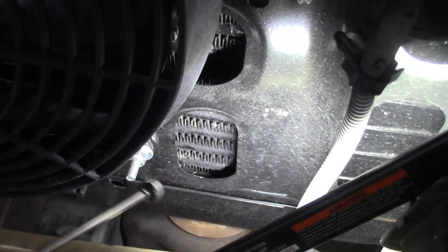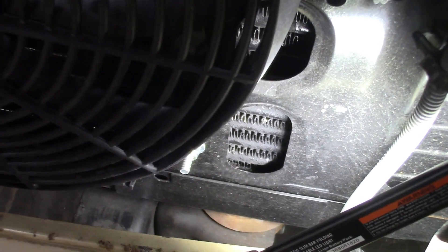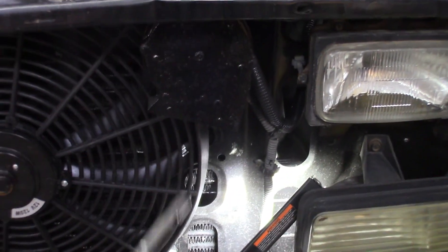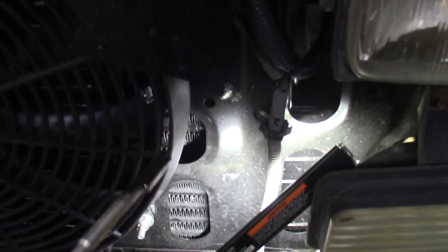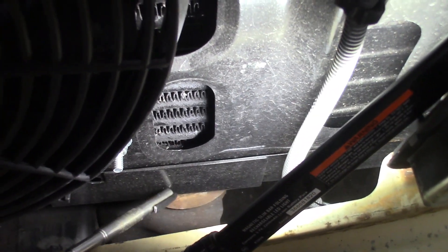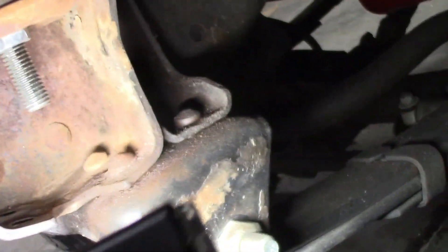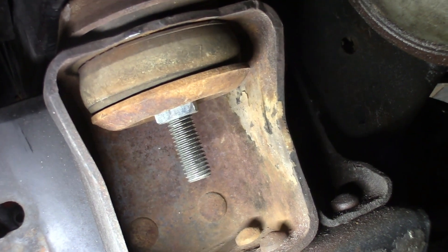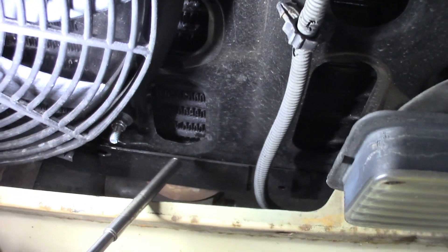I actually got ahead of myself — I shouldn't have showed you the intercooler mount just yet. If you refer back to that first video, you would know right here is the factory body mount, and there's some bracing that runs up and down this core support. You have to take those braces out. They're on the inside. And then, doing so, you have to mount your body bolt upside down. You actually have to run it with the nut on the bottom. Drop your bolt down through, and that bolts the core support to the frame. Hopefully I'm explaining that good enough.